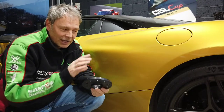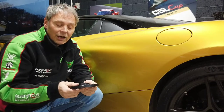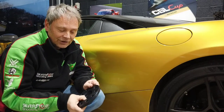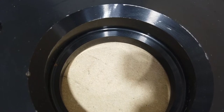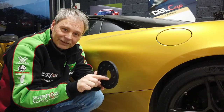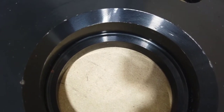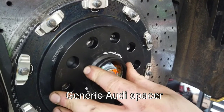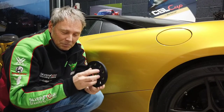McLaren has a very similar PCD and hub size to Audi, so you can technically use an Audi spacer on a McLaren. The problem — and it's hard to show on video — is a little recess inside there where the McLaren hub has a slight recess on the actual axle itself. Our spacers are designed to have that extra bit of milling just inside there, which means it's perfectly flush to the hub in every way — solid as a rock. Fit a set of Audi spacers and they will still do the job, but there is some movement because they weren't designed for the McLaren hub. They'll technically fit, but it won't be the same level of perfect fitment.